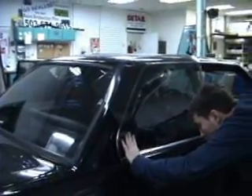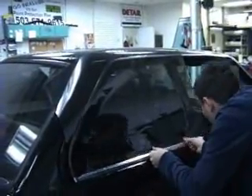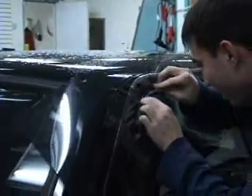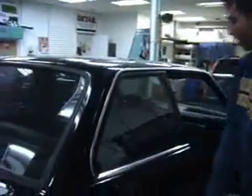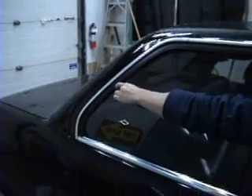This could be a double cut. The other window of this car has actually been broken out and we're going to tint it out of the vehicle, then the customer will have it installed. He's making this cut here and he's being real careful because you do not want to etch into the paint or the trim. A lot of times that film is not actually up against what he's cutting, and he's got his knife through there making that cut a little bit bigger than the hole. When he puts the button back on, he doesn't want stress bubbles on the inside because there's a gasket that goes up there, and if he left it just the size of the hole — always be careful. He's got his button in, he's trying to get everything lined up, reaching around — this is a hard job for one person.